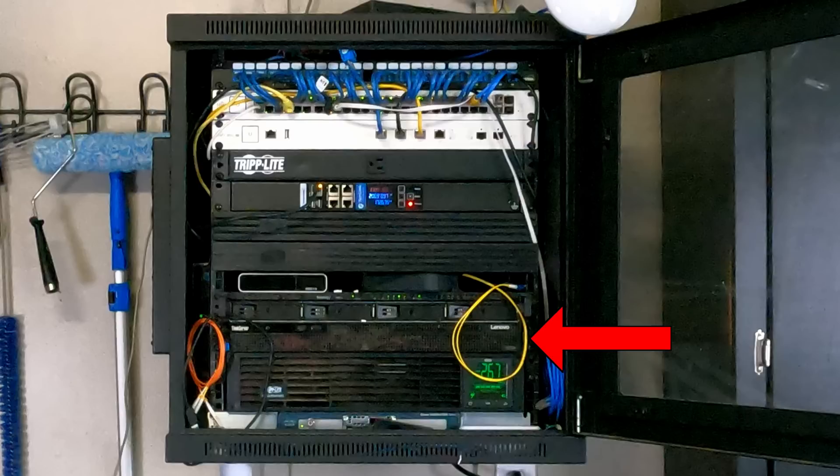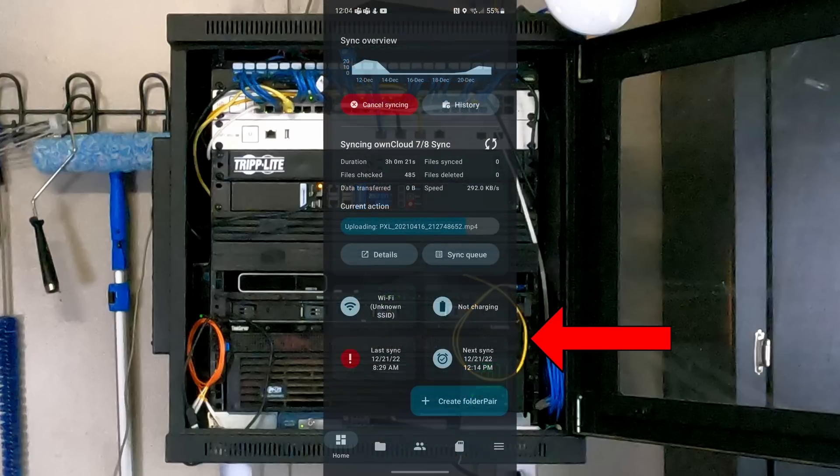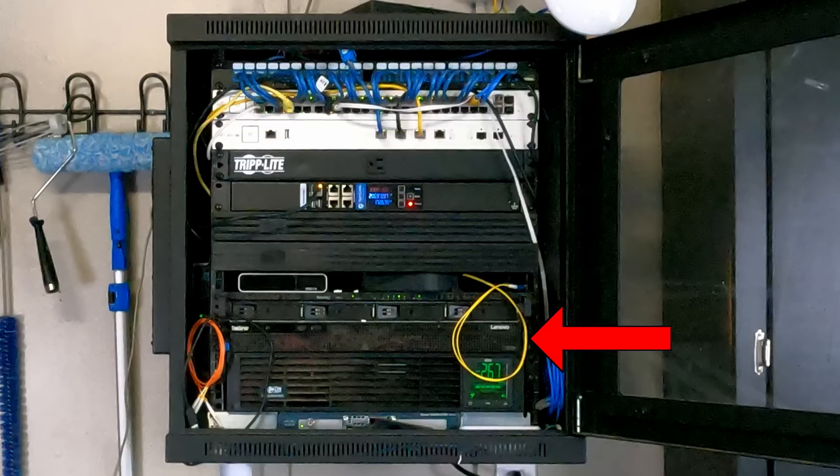The reason for OwnCloud is because my wife and I both have Android phones and we take a lot of videos when we're out and about. OwnCloud allows me to automatically upload any video taken with my phone up to a share on my server, which is basically just a mapped network drive to the NAS unit. At this point I have every picture or video I've recorded with every cell phone I've owned for about the past eight or nine years — and so does my wife. We don't overwrite and we don't do deletions, so everything's there, even the garbage.